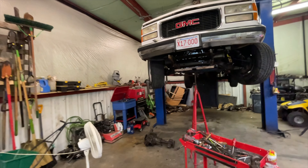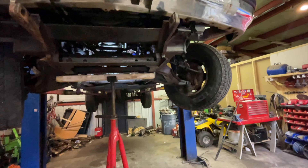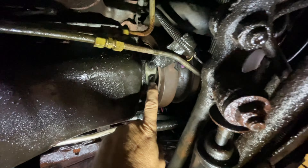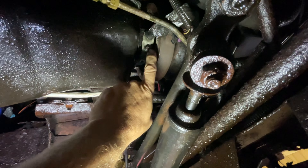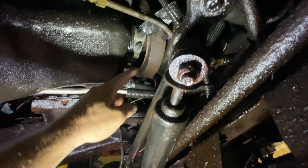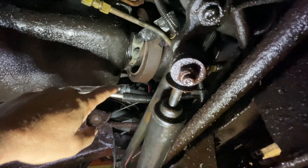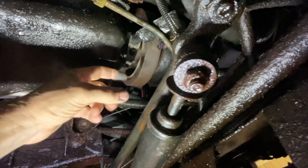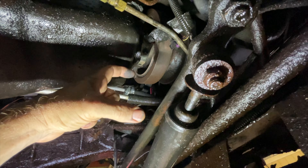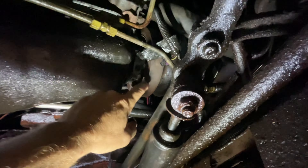It turns out that I had a little extra play in my crankshaft. The crank sensor right here has a magnet that stays a little bit away from a sensor inside a wheel on the crank that sends information to your computer to tell you the position of the crank - obviously a crank position sensor. It was happening because the crank had worn the bearings a little bit and I was getting that knocking noise, which is the crank bearings, unfortunately.